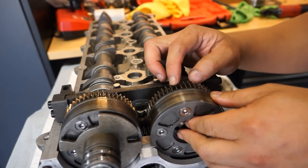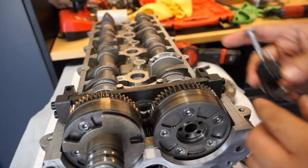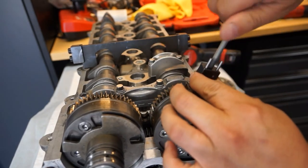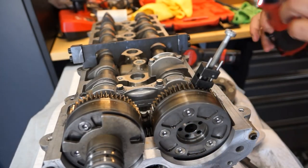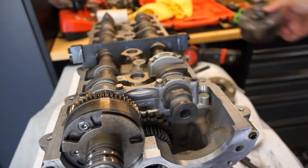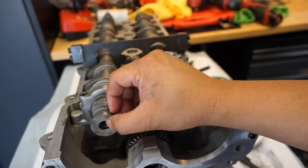Here's how you know you're doing things wrong — which I did. I took everything off without using the lash gear locking tool because I was trying to take the new adjuster out, and now it's stuck. If you're a shop doing this, do not skip this step — lock your lashes. Now I'll lock it properly — and when it's locked, it just pops out. Make sure you also remove your old washers and do not drop them into your engine.